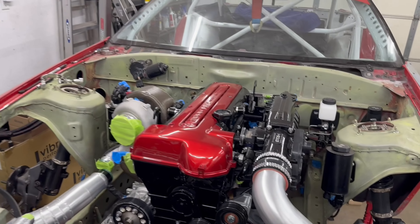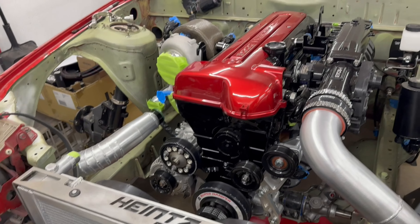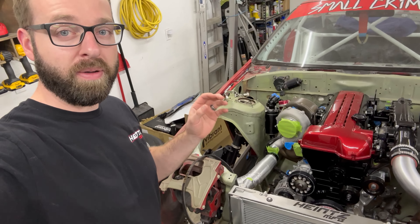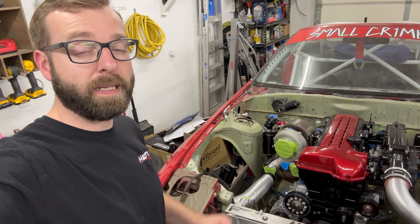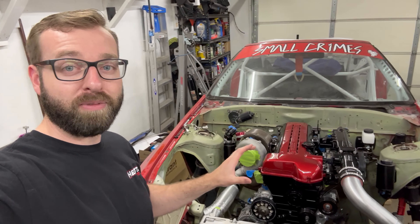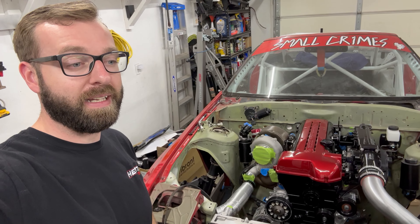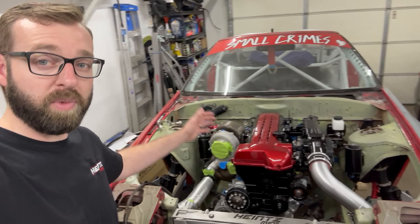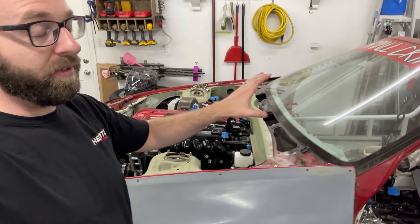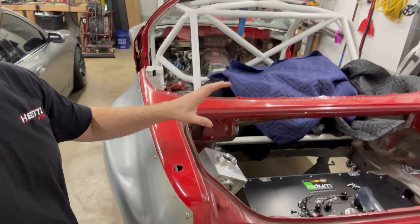This doesn't really apply to me moving forward with the chassis and getting it on the ground, but I'm trying to get ahead of it and create a solution for other like-minded people. So where are we going forward? I'm pretty well done with fabrication — there's not a whole lot left. I'm going to start pulling everything out and get ready for paint. I'm so tired of mocking things up, so I'm going to risk it, take whatever fabrication happens in the future, and just start rolling forward with paint. I'll pull the engine, trans, intercooler, and radiator, get everything into a storage state to prevent contamination, then start sanding the roll cage, interior, get the rear firewall figured out, and get the whole rear pulled and ready for paint.